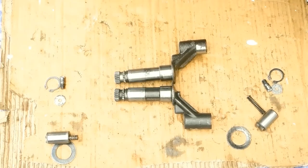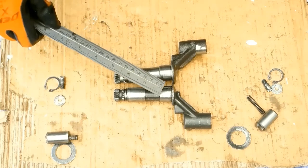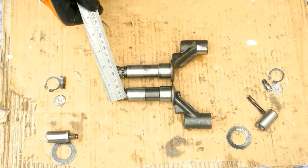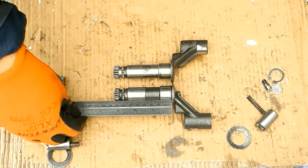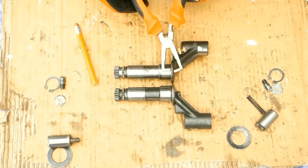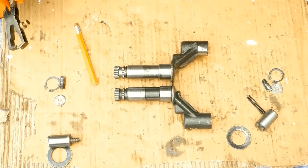I'll quote page 54. Identify the shaft. Early Li weak type measures 67.5. Later thick shaft measures 65. The measurement is from here to here, and both these shafts measure 65. So it appears I have two late model shafts fitted to my early model scooters. This explains a couple of things.